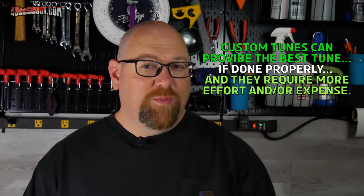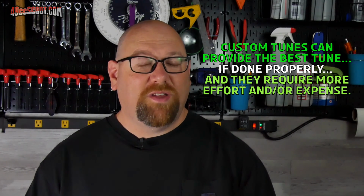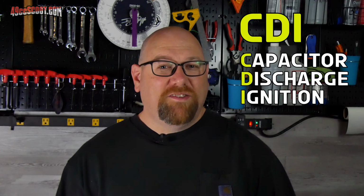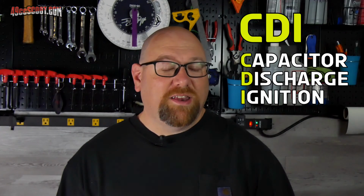If you can't find a pre-made tune that works, then you're going to need to find a tuner that allows for at least adjustments, if not totally custom maps. One note specifically about the Malossi Force Master 2 is that sometimes it's listed as a CDI, but it's a fuel controller and it does not change the ignition timing. So be aware of that and look elsewhere if you want to make changes in the ignition timing.